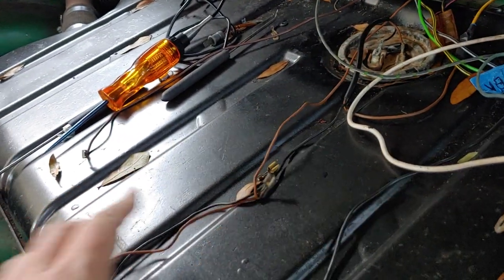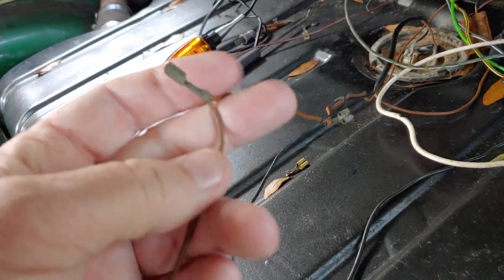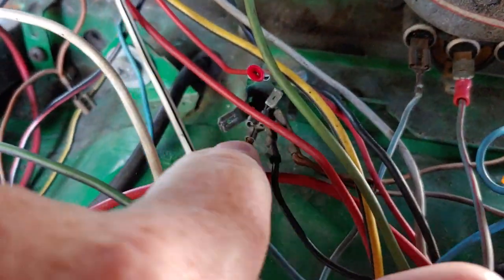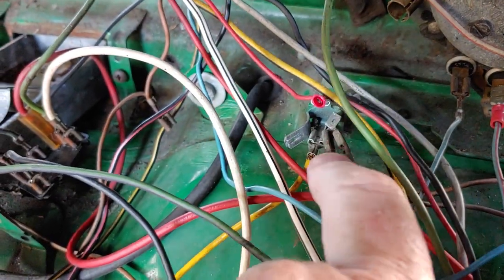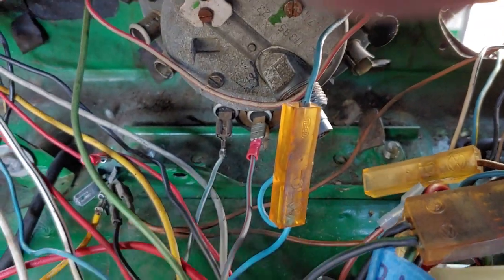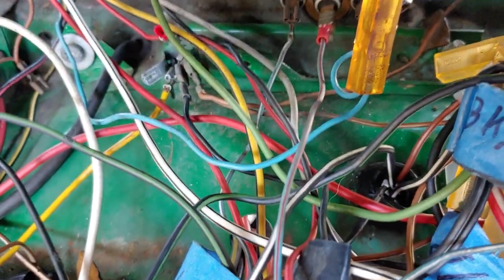Once we come off the ground of the switch, then we've got two other locations, and this is where I got to find where they hook up to. And we got the very end. So I know that it's more than likely going to have to go to the grounding star here. As you can tell, there's already some wires, but this is your grounding unit. On most bugs have this here. All the ones I've seen, from like '68 to newer, it's going to be like a little star right on the side of your fuse box. So that's always your grounding block for the bugs.